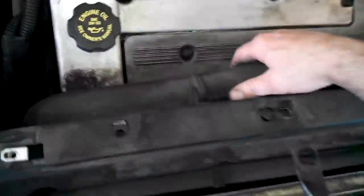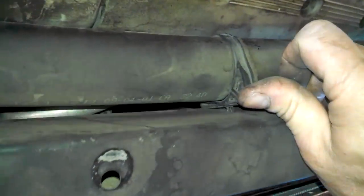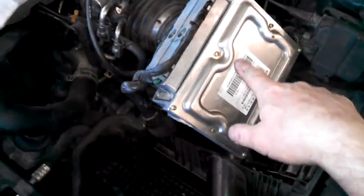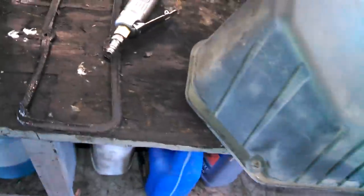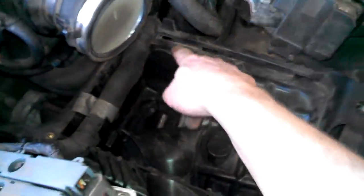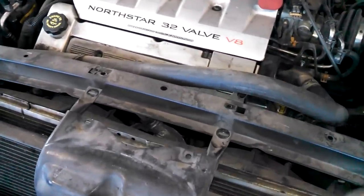Pull the radiator hose out of here. Also this bracket — you may or may not have it — you can try and pry it out of there. We should be able to lift this up and get it out of here. The computer just fits in a slot down here. Here is this piece — it's got nubbies that fit in holes on the back side and three 8 millimeter bolts. Here's the nubbies that fit into the holes right there. So we'll get this out and then work on the cooling fans next.